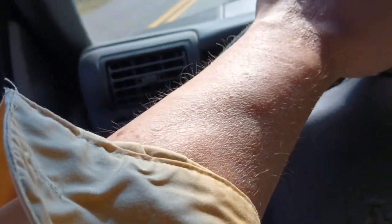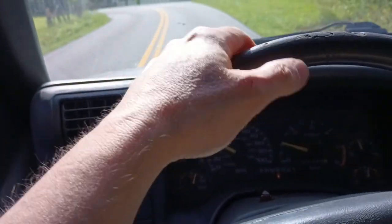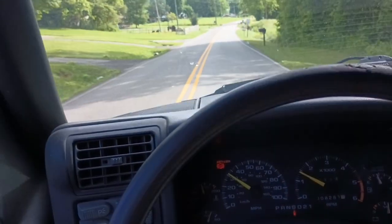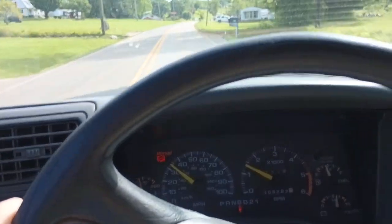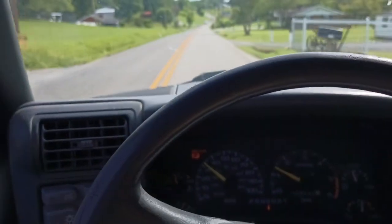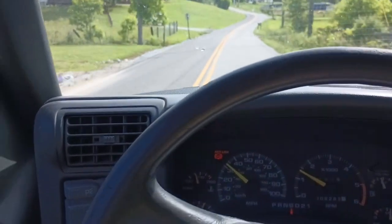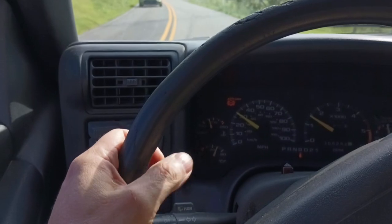Down to about 50-something psi. Now the full hot city idle oil pressure with the AC on full load is about 30 psi. So that proves that even though the coolant reads up, the bottom of the engine is still cold. There's no coolant and no heat supplied to the crankshaft and the bottom of the rods. Heat is supplied to the piston rings and cylinder walls through conduction from the piston crown, but that heat doesn't really reach the rods. So the rod bearings, crank bearings, and oil pump are still cold. These readings prove that system is an oil heater, because before this deletion, that oil would have been thinned down already.